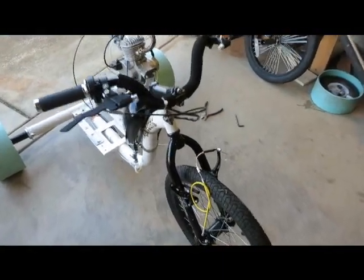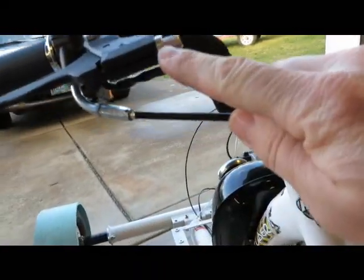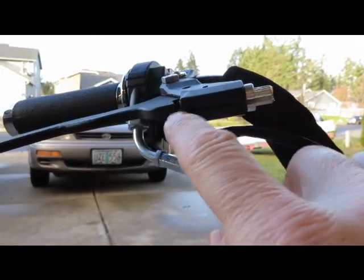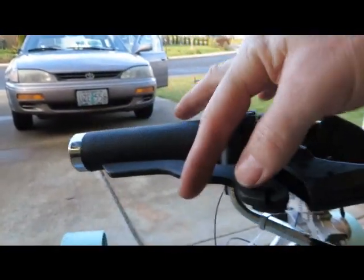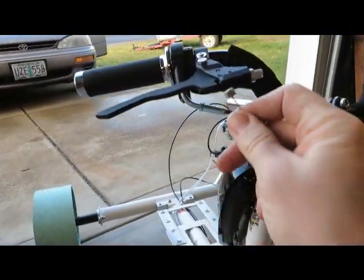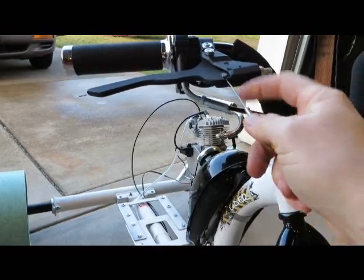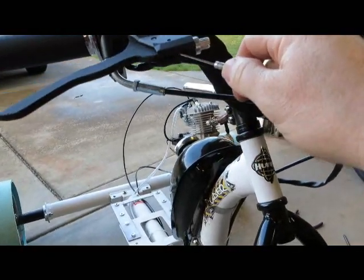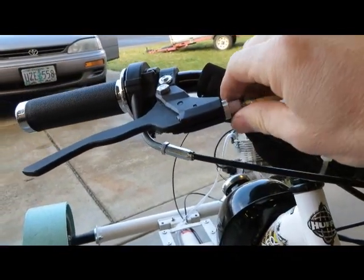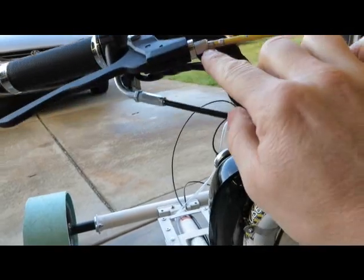Once the handlebars are on, let's plug in the front brake. Take the front brake cable out. On the handle up here it's got this nut and bolt — make sure the slit in the aluminum is lined up with this crack here, and there's a hole right on top there. Put it in that hole, pull it out a little bit. It should lay right in that slot. Put it in and turn this so the slot's not there so it doesn't fall out. This is a lock nut — you can lock that nut. So now the slot's not lined up anymore.